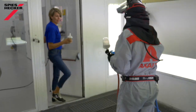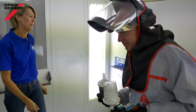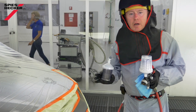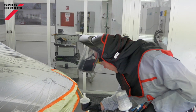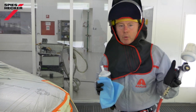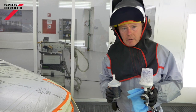Hi, is everything ready? Yeah, ready for use as you asked. Thank you very much. As you will see I have the two pots. As I've shown on our channel before, I'll give you a quick reminder of the blending process: I'll spray some blender out here, make my widest area first, then work back inside. The gun I'm using today is a 1.2, as I've done previously. Time to get the job painted — I'll see you in a short while.